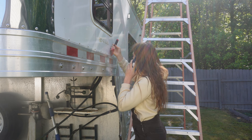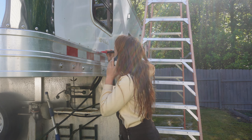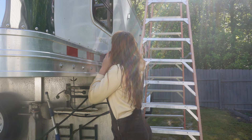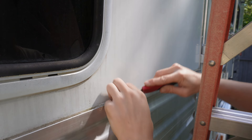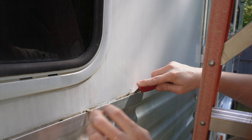Now if this were to happen in an RV, it 100% would have rotted out the wall, but because horse trailers are designed differently it didn't rot the wall at all. All that water was just draining down onto the floor, which is what completely rotted out the floor to begin with. Horse trailers are basically aluminum frames with furring strips — typically wood strips — attached to the aluminum on the inside. There's a significant gap inside the wall, so when water ran down it only touched aluminum, not any wood. That's why the walls didn't rot, which is absolutely great.